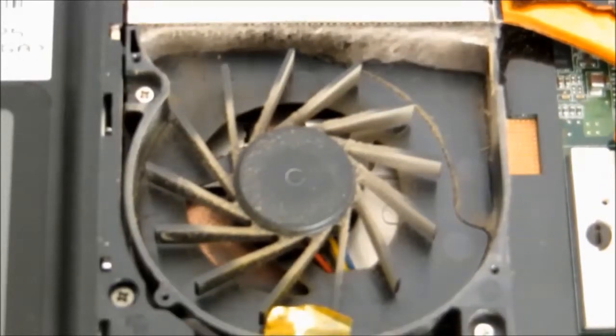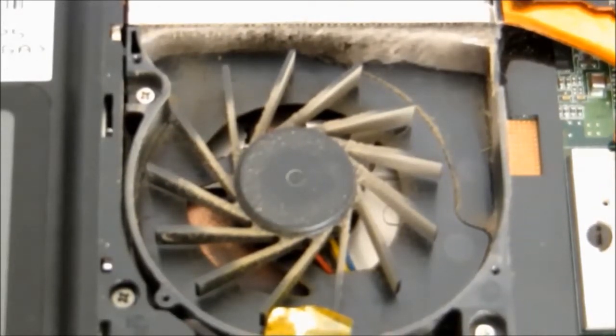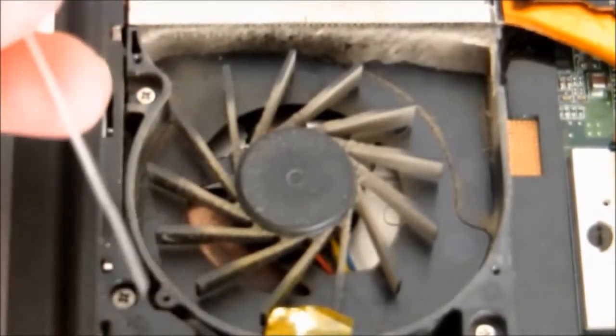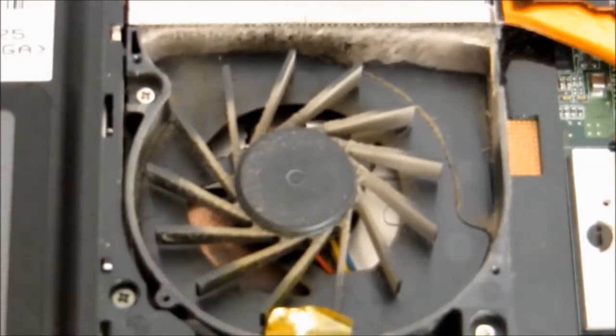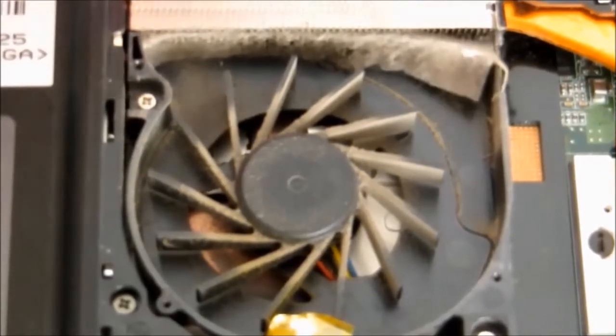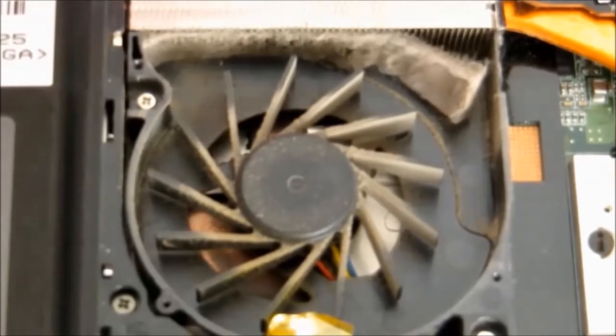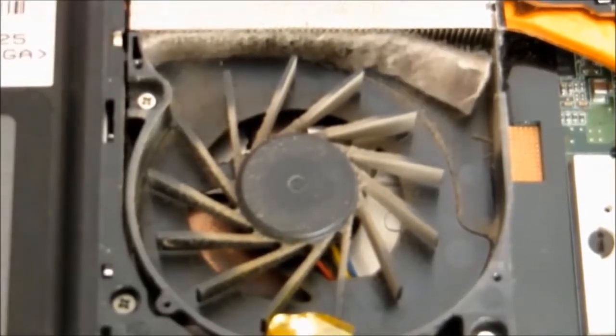Often it's practically impossible without taking the entire machine apart to get to the fan, so then you're kind of stuck. But one thought is that with a tie wrap, a piece of nylon or something similar, if you couldn't get access to the fan with your vacuum cleaner, you could push this from the back of the machine to dislodge the dirt and dust, which would then be drawn out by your vacuum cleaner — saving you from taking the entire thing apart. That's worth a thought.